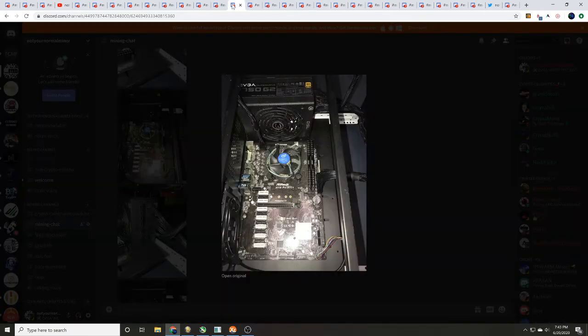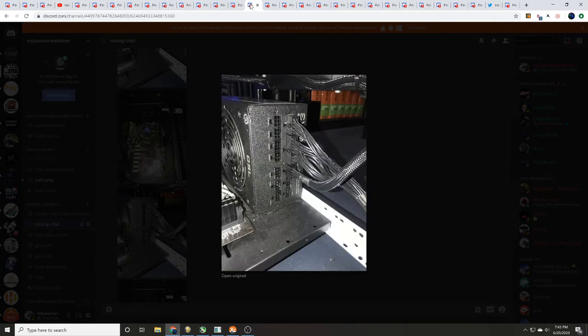Step two: on the back of the power supply it's labeled CPU, and on the booklet it says ATX 12 volt. We go ahead and connect that next — it's up near the processor and the processor fan. You can see that's right there above CPU 2. CPU is what we're plugging in there — it's a 4-pin connector.